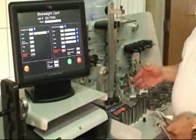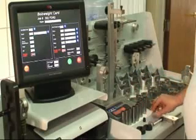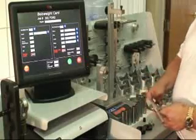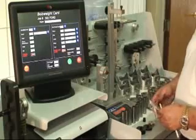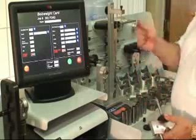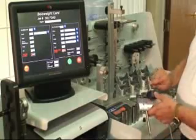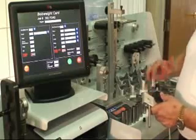Now that we have the weight set up and we know we're on target, we can lay these out by order. I can quickly count — there are seven units. I can take each one of these weights and add them up like laying out a poker chip table. Once we bag off the retaining bolt, the retaining bolt is there to hold these weights. Whenever you use quick nuts, which has been somewhat of a standard in the industry, there are cases where they have actually released and as a rotating issue that stuff comes off like shrapnel. Our weights interlock and maintain the same register throughout the build. You want to ensure you're building from large to small — don't reverse it, because it will change the moment center of the bob weight. This particular unit is called a Moment Match Set.